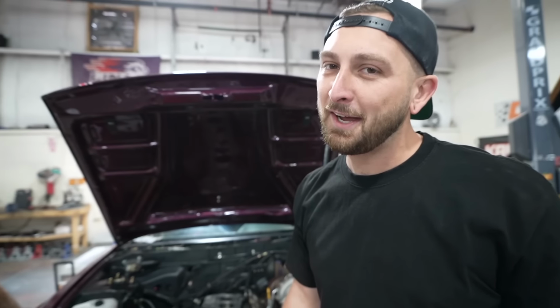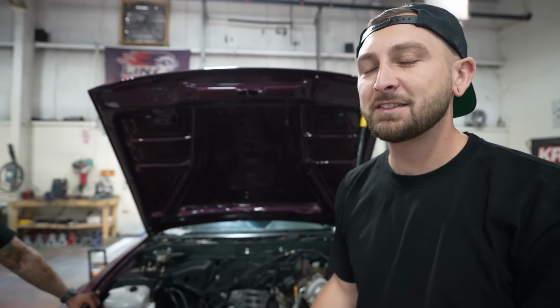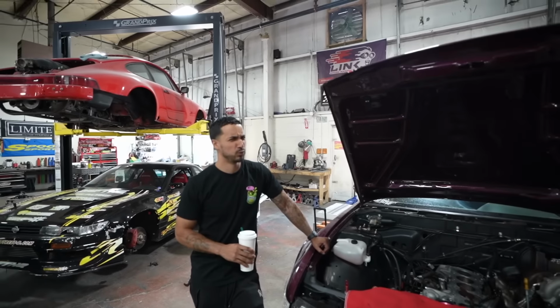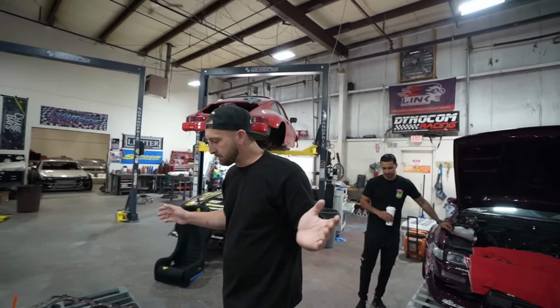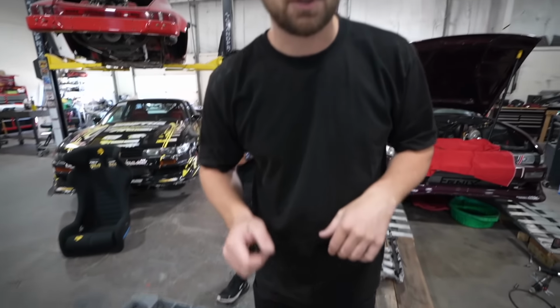As you can tell, that's a high number. Coolant pressure, we're not really supposed to see go over 16 in this situation, and as you guys might have seen in the video, we were touching 30. So it was one of those issues where it was just on the cusp of being bad. So, engine's apart, gotta wait for a new head gasket to come in, we'll slap it all together, and then guess what? SR will work, and SR is best.